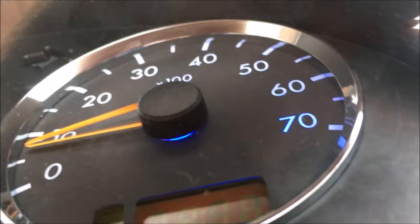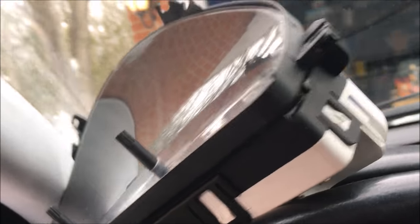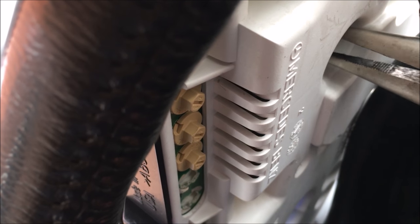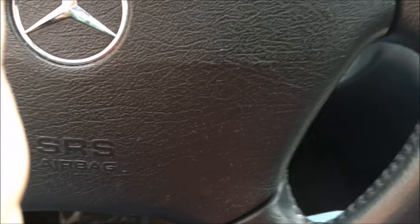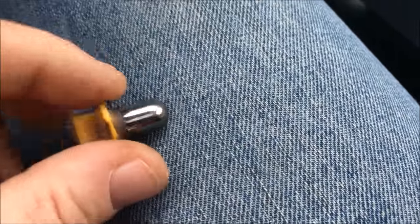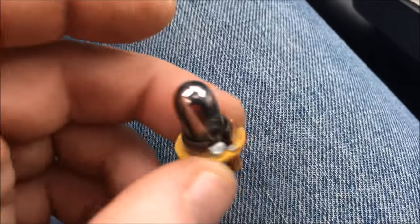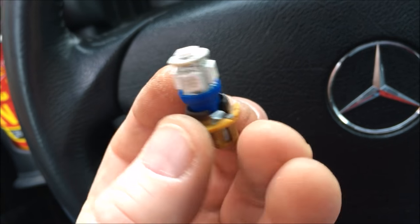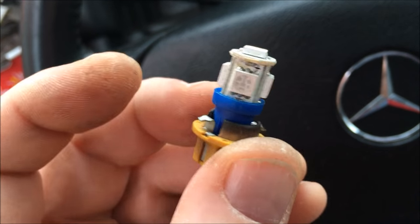It's light so it's hard to see, but I did get it the first time. Now for the T10 bulb - that's simply a pair of pliers - the two big ones on the back are both T10s. Turn and pull it out, pull this bulb out. I'm going to stick the other LED in there - it's a 12 volt, 5 watt. The T10 LED goes in the socket and this one doesn't have to be altered at all. The bulb just pulls out and this one pushes back in - you don't have to pull these little fingers off.